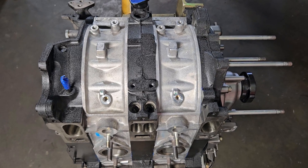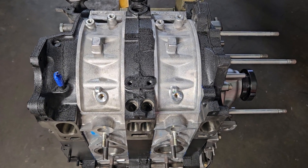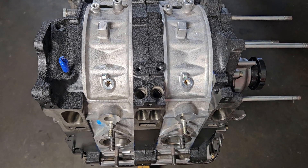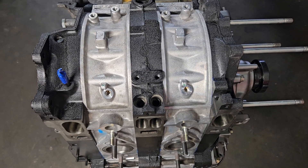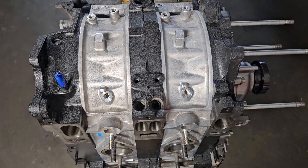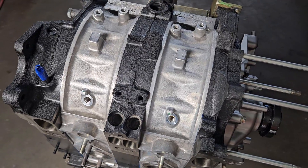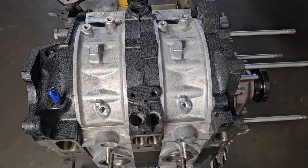There are times where you can get away with low-mileage rotor housings, but in most cases if it's a high-mileage motor, if it's been used, abused, or overheated, then you should probably expect to need new rotor housings. They are not only a vital structural part of the block but also a vital running surface component — you're not able to build good compression or have an expected long lifetime if your rotor housings aren't in good condition.